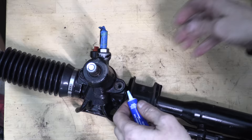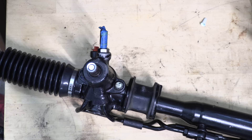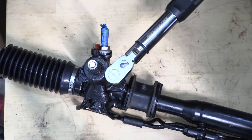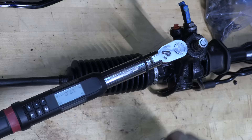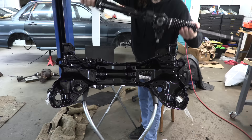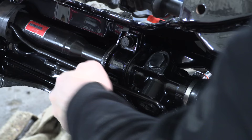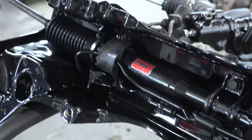The control valve bolts are only hand tight right now — they're supposed to have thread locker on them as well. I went with 17 foot-pounds. I feel more empowered when they give me a range to pick from. Check to make sure all your lines, fittings, and lock rings are tight. I don't want to have to see it again anytime soon — all I really wanted to do was start reassembling this candy-like shiny front subframe. What a month of preparation has been all about, and rebuilding this rack. But it turns out this was really a Koyo power steering rack rebuild video after all.